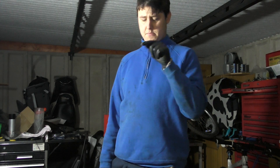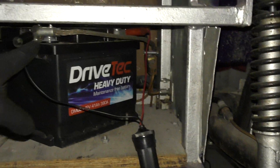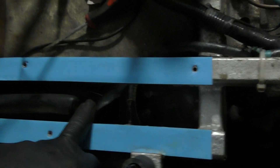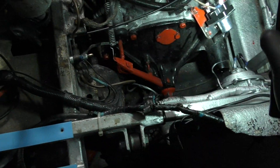I've got in here the positive and the negative battery terminals. What we're going to be doing is from the battery under here at the back, I'm going to take the positive from here and run it round and down through the gap in the back corner behind that post. I'm going to run along the inside of this body, through here, take this panel off inside which is the interior trim, and then it comes out just inside this panel, comes out round and then it'll go round to the starter motor.